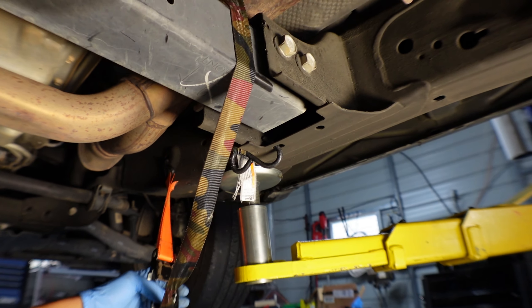I'm going to go ahead and wipe these and clean it all up. Same thing with the gasket. These are reusable gaskets with metal inside — still not leaking, so good. I'll clean underneath the transmission too. I'm going to spray brake cleaner and let it dry. Now it's getting really clean — same thing on the bottom side. Now we're underneath the car again.